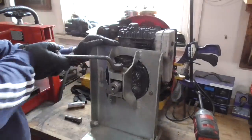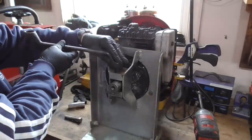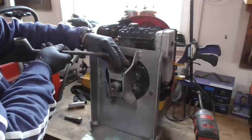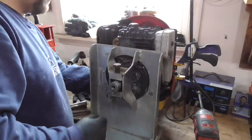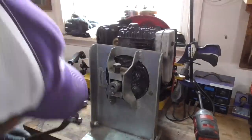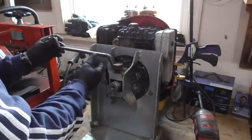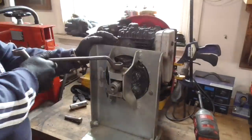We're already straightening it a little bit. I'm going to back that off and see if we can at least rotate around. We're hitting the top again, so go a little tighter. You don't want to bend this thing all at once — you want to do this in several passes. You can feel the pressure as you tighten up these bolts. Give it another half turn.